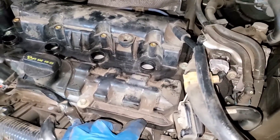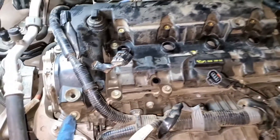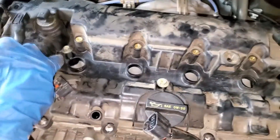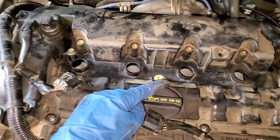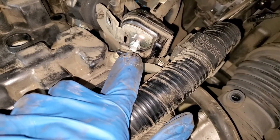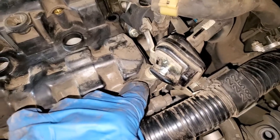The next thing we are going to do is remove this piece and then start undoing the bolts. We are going to start removing them with a 12mm socket — all these bolts across the front, then here, top, bottom, and then on the back side. In addition to the bolts around the perimeter, there is one here and one here that also need to get removed. To gain access to one particular bolt, we are going to have to undo this 8mm bolt in here so we can unhook this and move it out of the way to drop the ratchet or impact gun right above that.